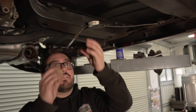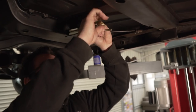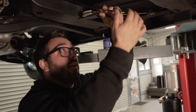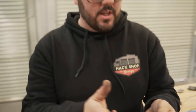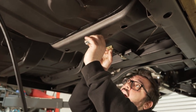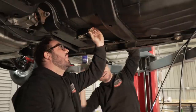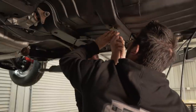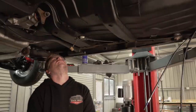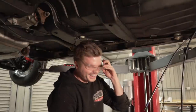The kit comes with this piece that unscrews — we're going to ditch it so it goes straight onto the original cable. Same thread, so it goes straight on. We'll mount the plate there, these cables will meet to it, and pull — beautiful. The outer sheath will go into the bracket and the cable will come through. We'll nutsert that to the floor and it's as simple as that — the only exposed cable is that short little distance.